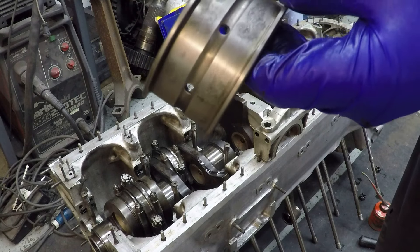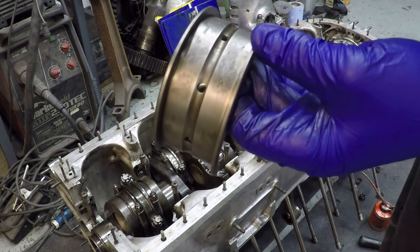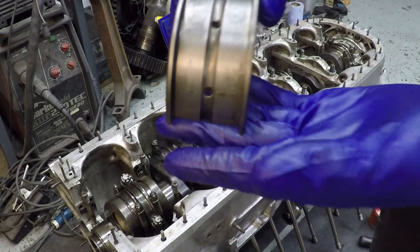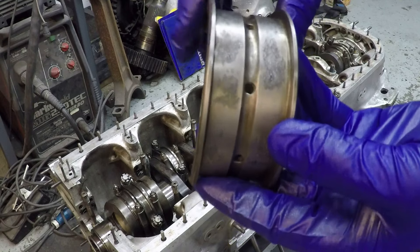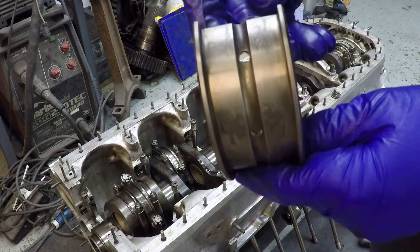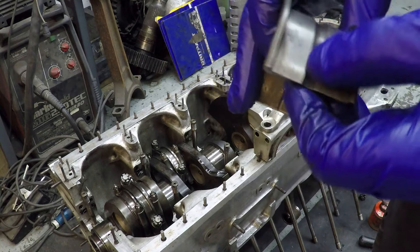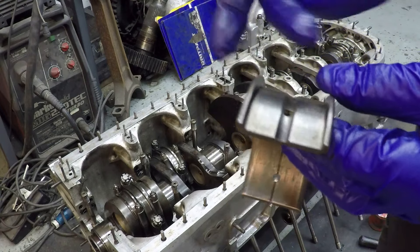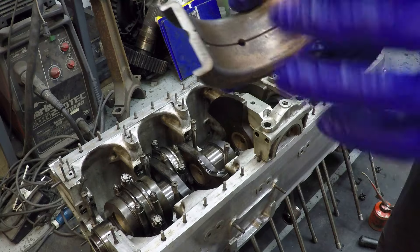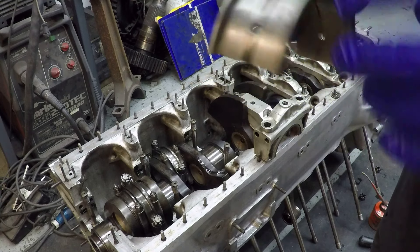One of the issues they get is small amounts of fretting — basically these patches on the back of the shell are aluminium from the crankcase, picked up through vibration. Even though these are really tightly clamped, there is movement in the crankcase because it is quite a light engine for its power output. They had quite large problems with fretting on some of the later post-war engines, particularly on civil aircraft doing long hours, to the point where they had to make bearing shells with a larger outside diameter, machining out the crankcase to suit. I think this possibly is actually a late one — that part number looks like an oversized shell.